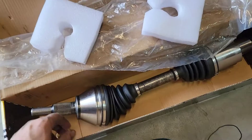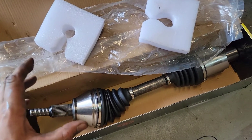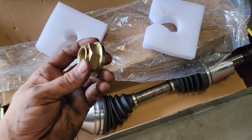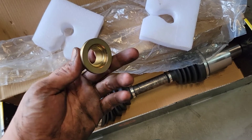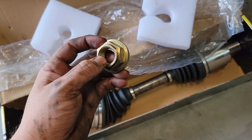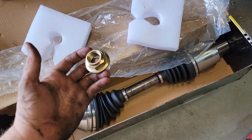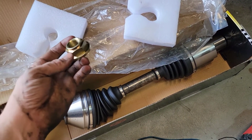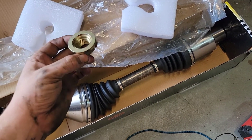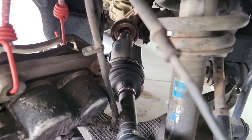The DTA axles are packaged really well with good cushioning. One nice thing — it comes with the spindle nut. The Dura-Last Golds did not include one, and I actually spun the threads right out of mine with the Milwaukee impact wrench and had no replacement. The parts store had to open another box from a different brand just to give me a nut. It's a really nice feature because you can't just go buy that nut separately like you can a caliper bolt.